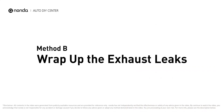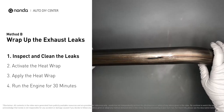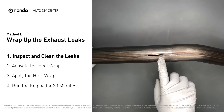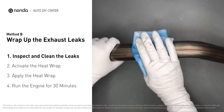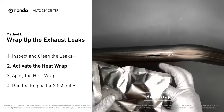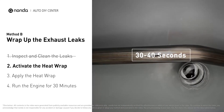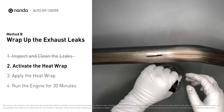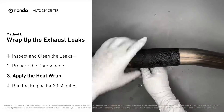Method B: wrap up the exhaust leaks. Exhaust pipes are made out of rolled steel, and there is a welded seam on them. Like this one — the seam will often rot and leak. First, get sandpaper and a wet wipe to clean the leaking area for better application. Get the heat wrap out and put it in water for about 30 to 40 seconds to start the activation process. Then remove it and squeeze out any excess water. Wrap it around the area and overlap it a couple of inches on each side. Repeat the process three or four times.